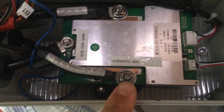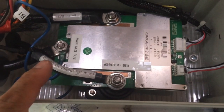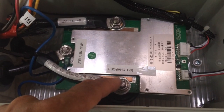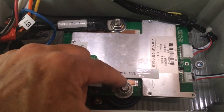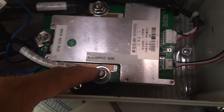I decided to separate P minus and C minus to give more possible ground connection, because I had issues where instead of terminating the battery-to-battery charger connection directly here — so it has very little resistance — I thought stacking it onto a bus bar just a few feet away would be okay. But it didn't work. Once I stacked it directly here, all my voltages were fine.